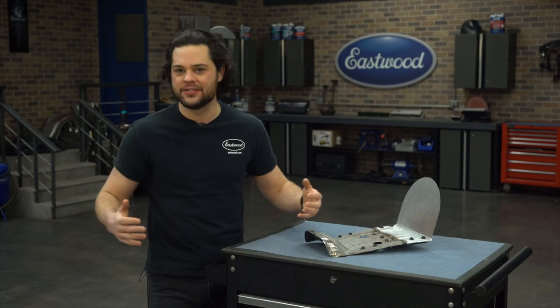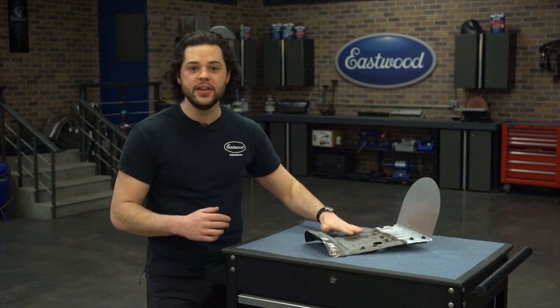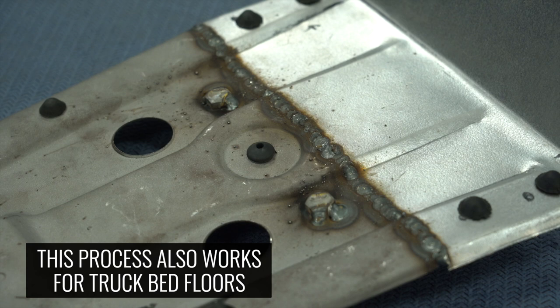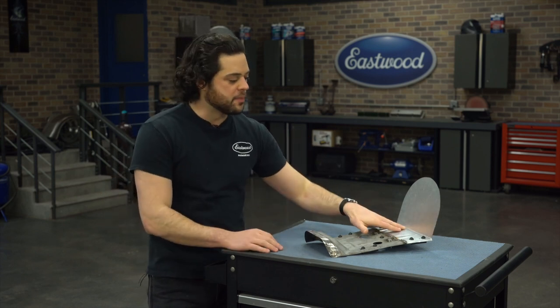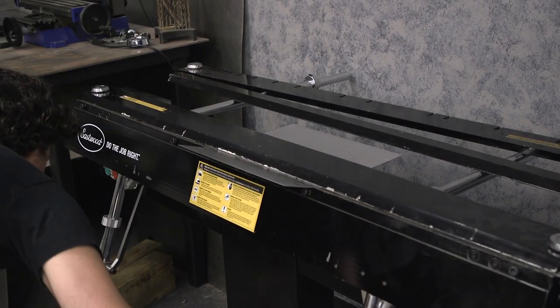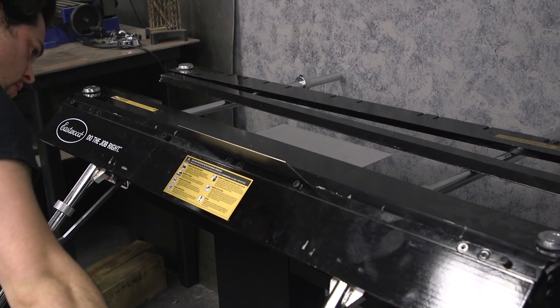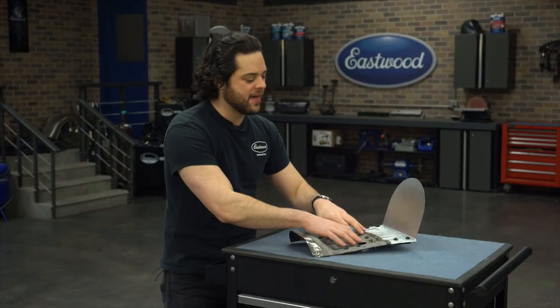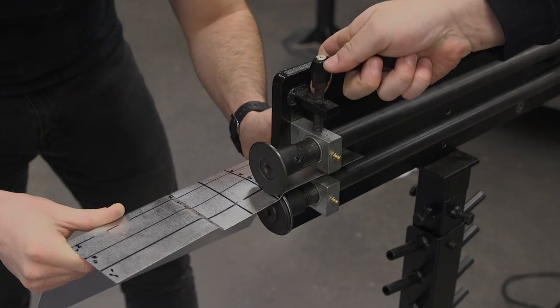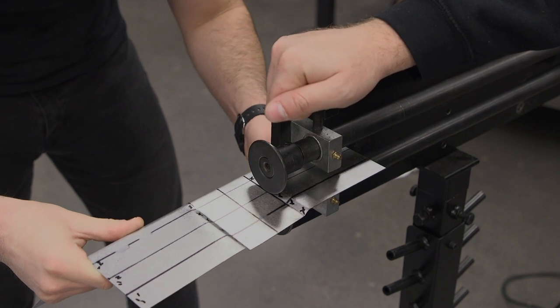I started by rolling a ton of test pieces to try to match the shape of that factory pan. I needed to find the right setup to match the height of each step, find the angle that it steps down at, and keep the lows and the highs parallel to match the shape perfectly. Once I had the offset dies dialed in, the next challenge was how to transition to the bend at the rear of the pan. My plan to go from the stamped shape at the front to flat again — so I could get that bend — was to make some horizontal reference lines and feather each bead roll out evenly as we progressed at a standard rate.